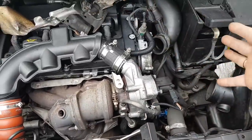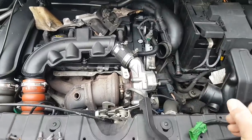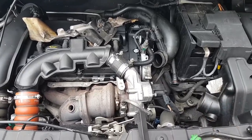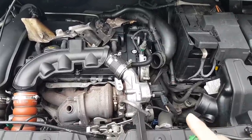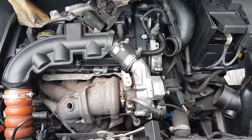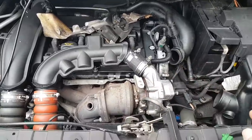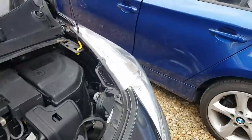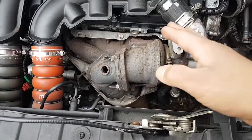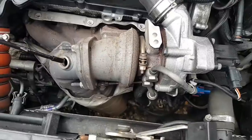There was one last thing to check. Interestingly, a friend of mine had the exact same issue on a Renault and I suggested he check the catalytic converter — and it was the cat on his car. Now in my case, I suspect the same. I'm going to put the camera in through the oxygen sensor bung and look at the cat without even needing to go for a drive.